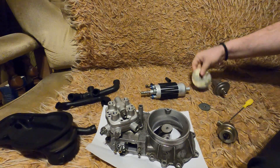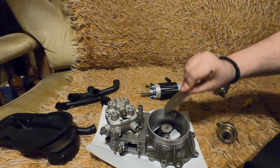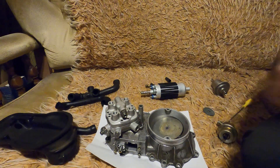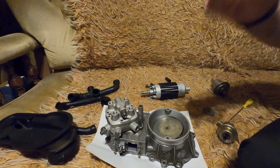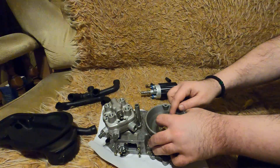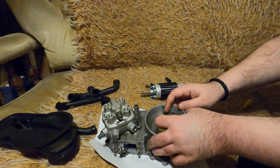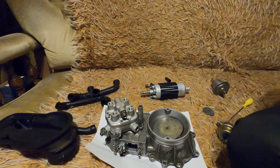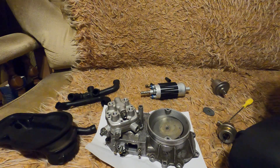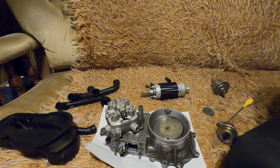The second solution is this: you don't have to unscrew the injector line — I did it just to clean and wash it. Then you set a gap of 1.9mm. That can be solution number two, and then you can have the best mixture — neither lean nor rich.